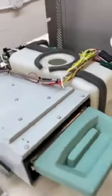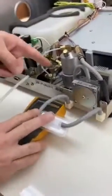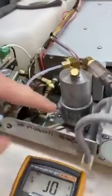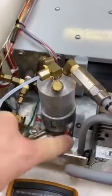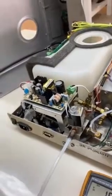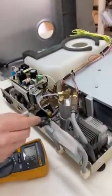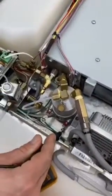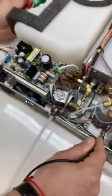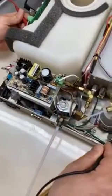We're going to come to the back of the machine. I have a multimeter — this is how we check the double thermal fuse. The double thermal fuse runs from a post underneath the boiler, through here, all the way up to the side of the PC board in the back. It is wire number three. Take one lead and put it on this post, then go to the board and put the other lead on there. If it beeps, that means the double thermal fuse is good.